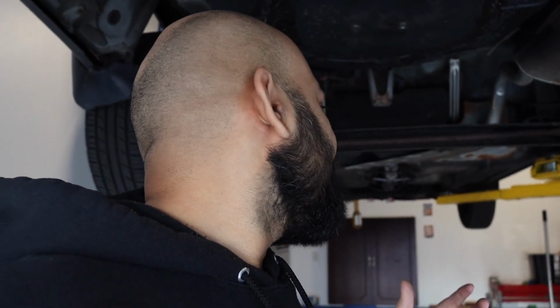After the break-in period, you want to wash out all the metals from the machine shop that got into the motor, since the motor is new and everything was flowing throughout. The oil filter is going to catch a lot of the metal particulates, and the oil is supposed to catch whatever particulates are in there and flush them out. So this will be great.